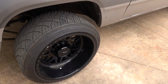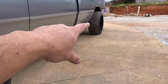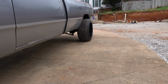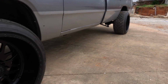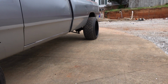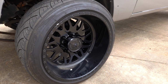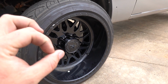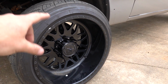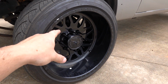One thing I want to answer real quick, you guys always ask me this question, so I want to go over this again. Most of you know we swapped a Dana 80 disc rear in the back, much wider than the factory rear in the first gen. This all comes down to wheel studs. In the back, we went to 9/16 studs, just because that's what that rear end has. The D250s, the two wheel drives, come with some really small, I almost want to say half inch, really short stubby studs. That's a weird setup with the way they have this front end configured. They have a hard time with some of these bigger wheels.